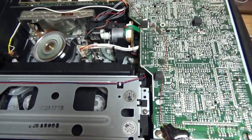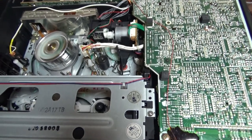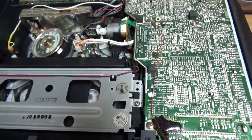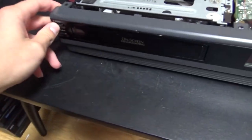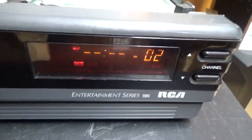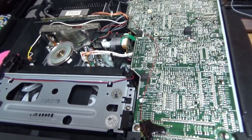Oh okay, this time it loaded correctly. Yesterday it was doing the trouble almost every time. This is what happened — the motor keeps turning, and if I press eject it won't eject. So it did not hit the tape yesterday, and now the VCR thinks that there is no tape in, so it won't eject — it is basically waiting for you to insert a tape. So what I did is I have to turn it off and turn it back on.